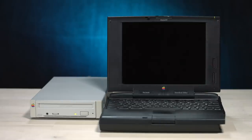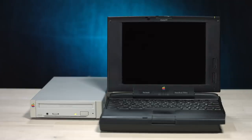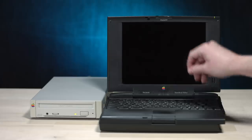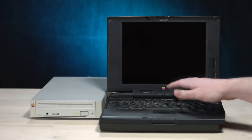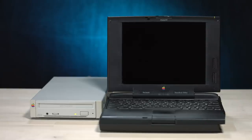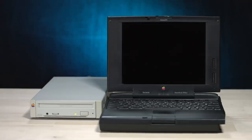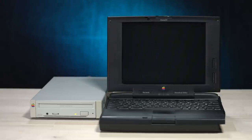We're now having a case of green light coma. It is actually an issue — I have had it with this computer before. The power light just stays on but the computer doesn't actually turn on. I believe the way to fix this is to reset the PMU — the power management unit. All I was trying to do was reset the PRAM to maybe get the display thing to change, and we got green light coma. On this particular model it's just a switch on the back. I believe that is the PMU reset.